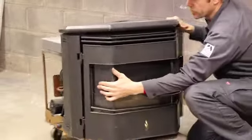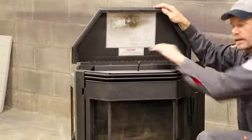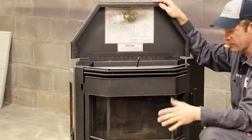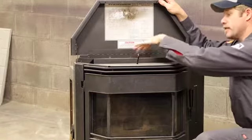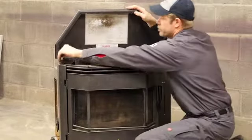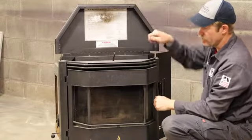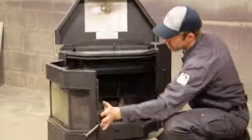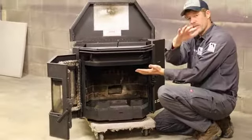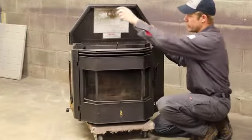The hopper opens up and this is usually where the label is. So if you have a defective or broken stove and you need to find a new auger motor, combustion blower, convection blower, snap disc, or anything, you'll need the make and model — it's usually accessible inside the hopper. Oftentimes there is a little handle on pellet stoves that goes up and down or in and out, and what it does is scrape and clean the heat exchanger tubes on the inside. Flame heats the tube from the bottom and the room air blower blows air through the tube — that's how they heat.